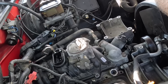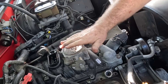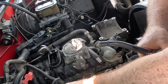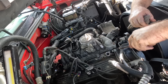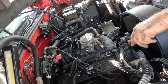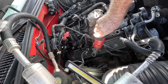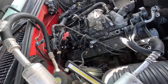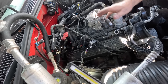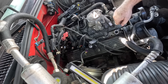Let's see if we can lift this off. I've got to get a pry bar and find a couple good spots to break the seal — then it should lift out. Feels like something's still holding it. Never force — give it a little love. It doesn't want to come loose in the back where the leak actually is. Looks like it's hanging up on the valve cover ridge. So I've got to take at least one valve cover off, maybe both. I normally don't have to, but I'm not going to force it — I can see the valve cover flex when I lift up.